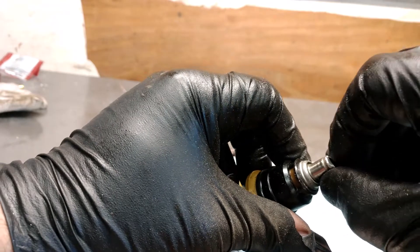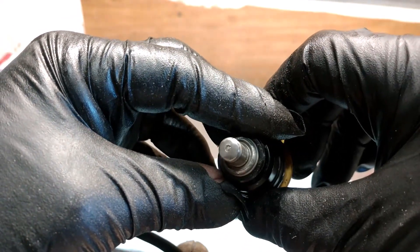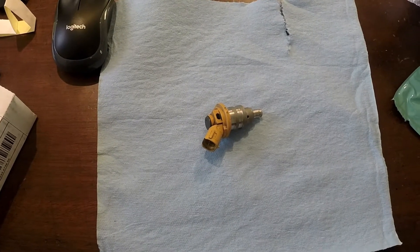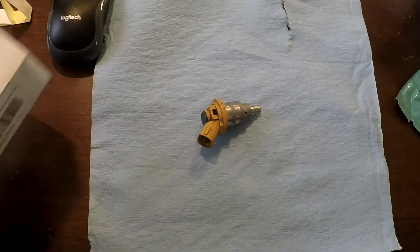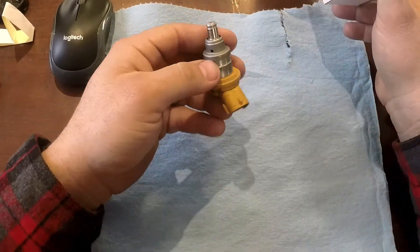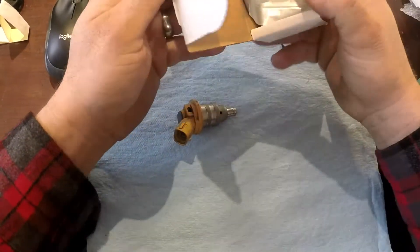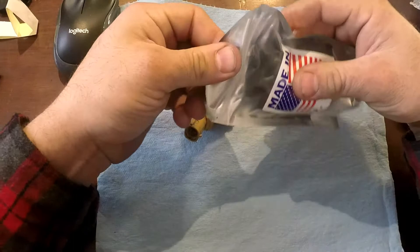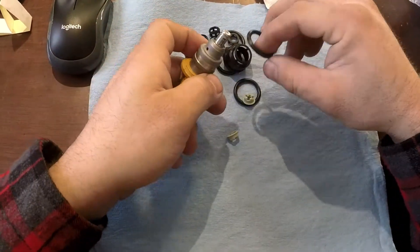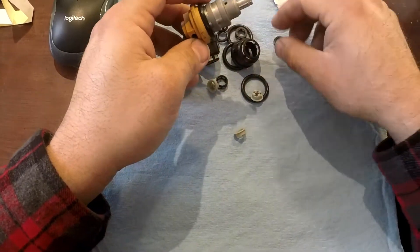If you have any grinding marks in the tip, then you went too far. I shot this video today with the GoPro and it's difficult to hear me so I'll just do voiceover. I got the injector decapped, sprayed off some brake clean, and it's ready to put the new seals on. I got this seal kit off eBay — it was $15, it comes with all of them, they claim made in USA, and it does look to be good quality. I can put a link in the description.